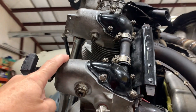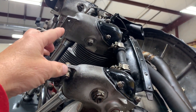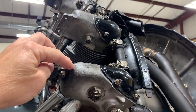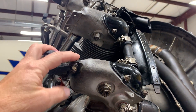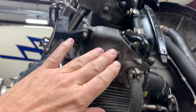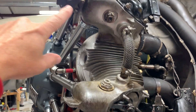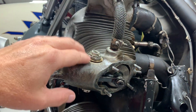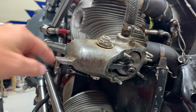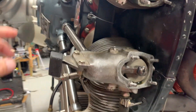The dog bones are between cylinders, so you've got to adjust one clearance and then turn around, put the other cylinder on top dead center, and then do it. As you move down, this one will already be on top dead center because you just did the one above it. So now we can go ahead and set this clearance, then you have to turn the prop again to get on top dead center for the next one and continue all the way around.